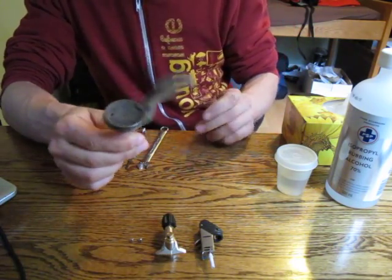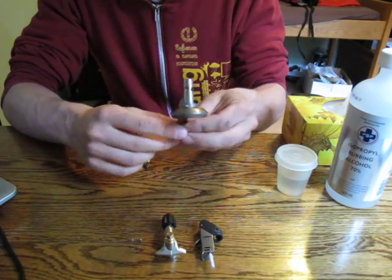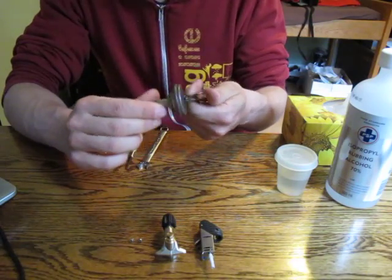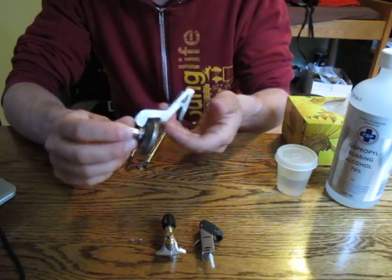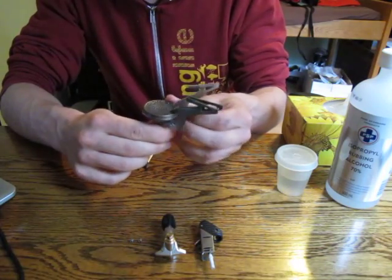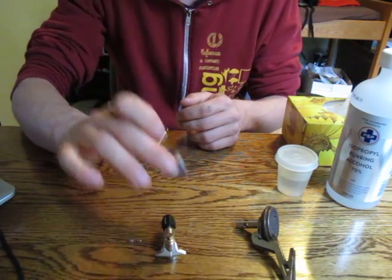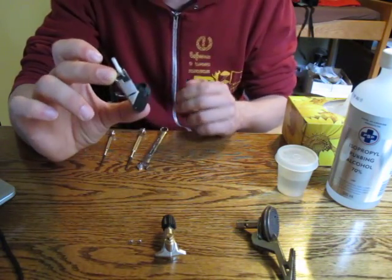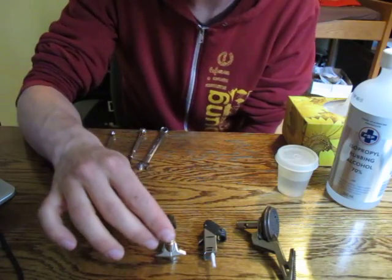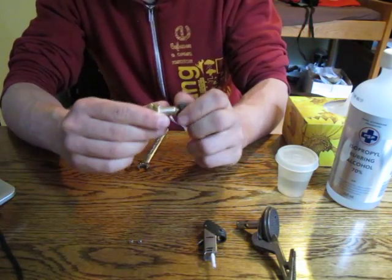Now you have the stove head and you're able to clean it out, rinse it. I'd suggest using rubbing alcohol. It'll help dissolve any gunk in it. Just put that aside for now. If the ignition is broken, there's not much you can do about that. Then the valve and orifice assembly.